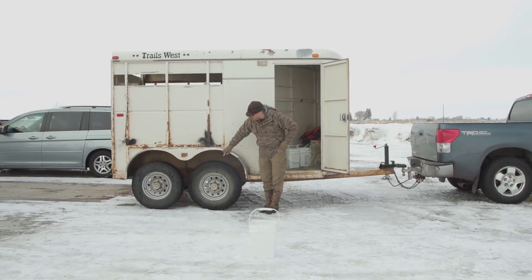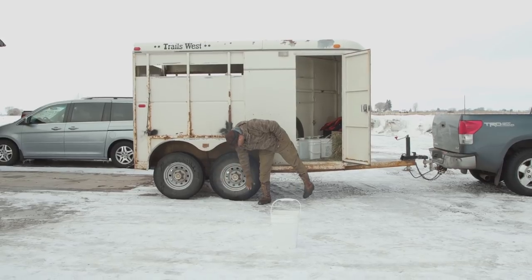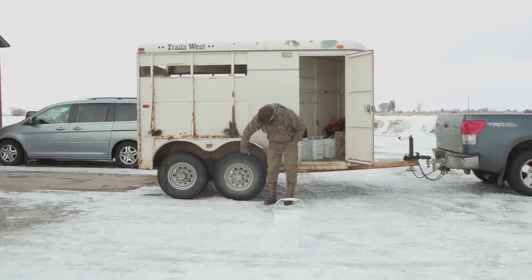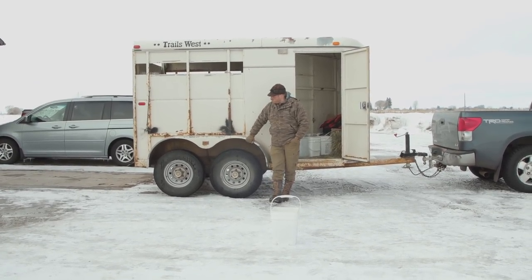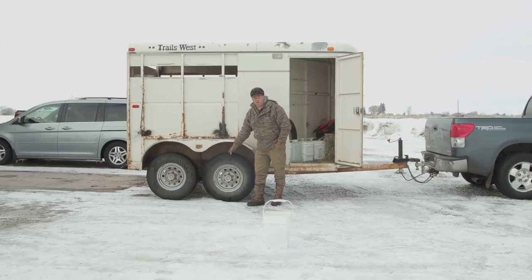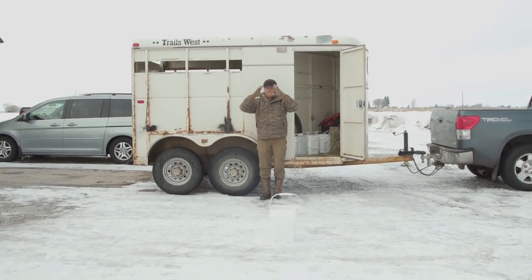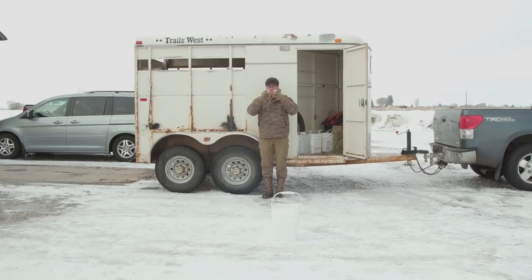What we did with this trailer is we flipped around the axles - my friend Bob Potter did that - and then we've got big old tires. These are 18-ply tires used for small semi-trailers and things like that. We still have quite a bit of clearance between the bumper and the tire. When you do a custom change like this on a trailer, you've got to consider how much space you have between your tire and your fender, because when you get rocks, snow, or mud building up, the more clearance you have, the safer you are.